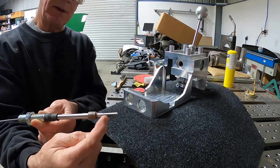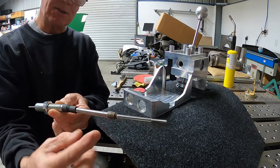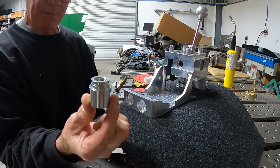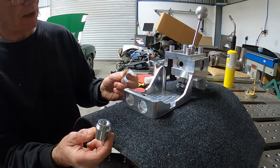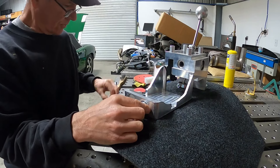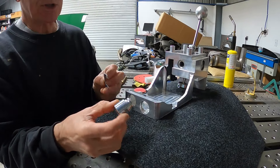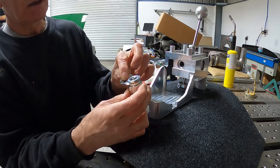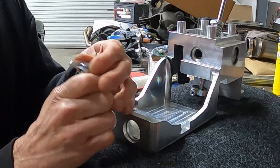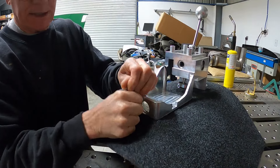Here's the Control Cables setup — this end piece actually threads on. I can get this cable measured out to any length I want. They make a metric M6 by 1 thread, and I can spec all the dimensions of how much cable I have on each end, picking that up right from the stock Ferrari measurements. The acid test is what happens when we put this piece into the shift block. This is the clip for the Ferrari — and it goes in. It's a push fit — oh, look at that. The factory Ferrari clip dimension can work.